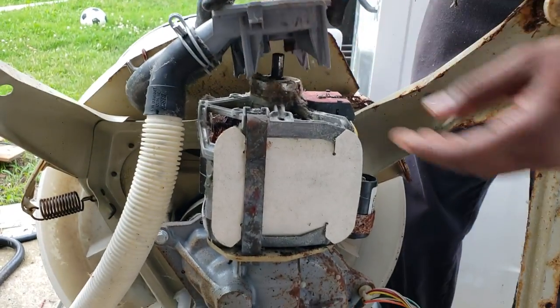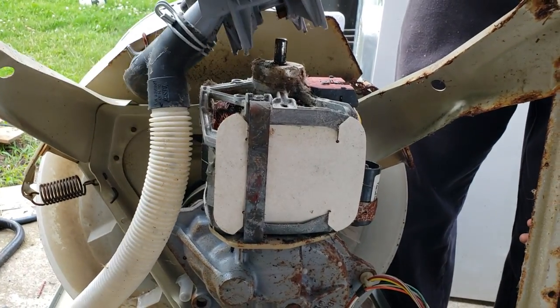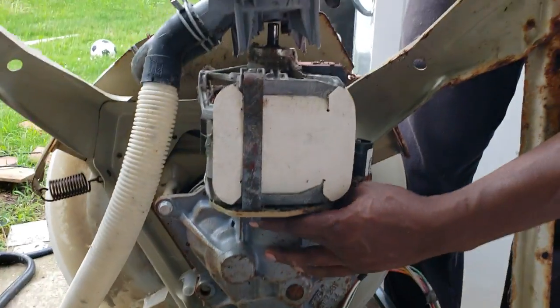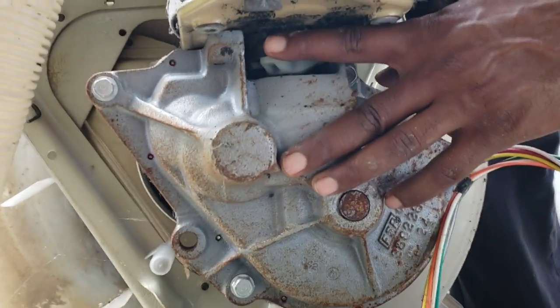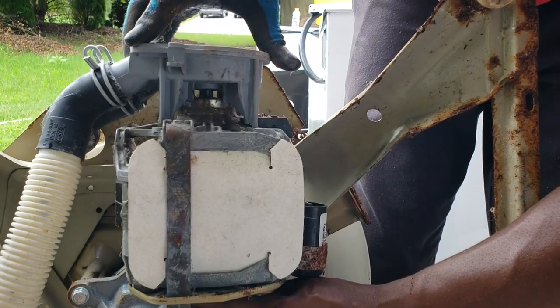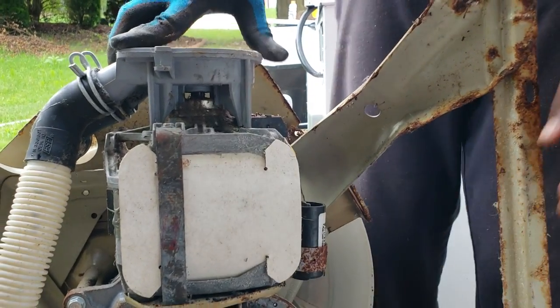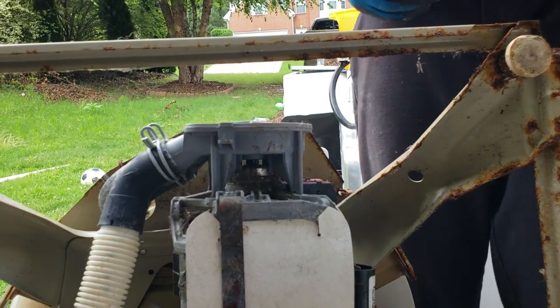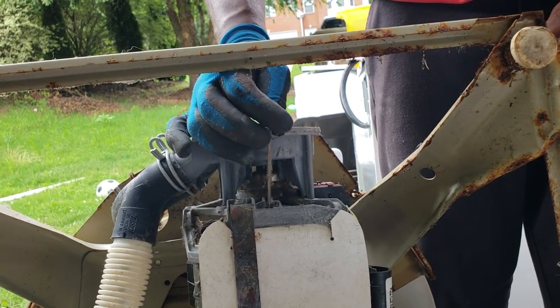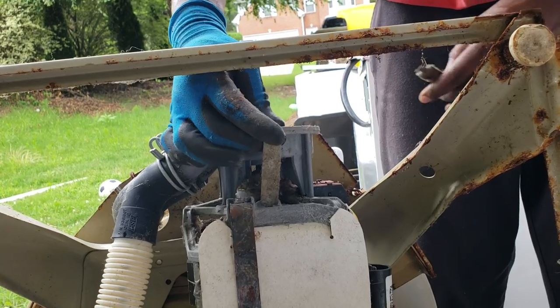And you put your... Now, this thing has to line up because it's oval shaped. What you do is, I will, by hand, go underneath here and turn the coupler, which turns the shaft, and will line up the pump. That goes straight on. Put on your brackets.